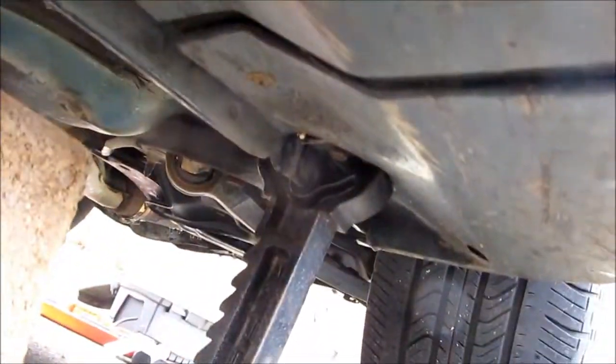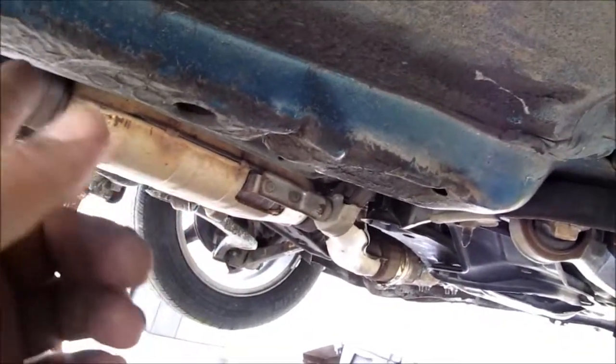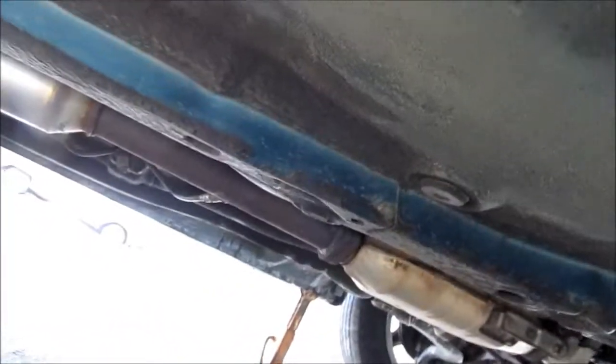Another kind of interesting thing about these Mitsubishis, well, I don't know if it's Mitsubishis in general, but this body style, which I did not realize, is that you have to lift them by this lift point along the edge. Now, it was my understanding that you only did that for doing tires until I realized that if you put a jack on the actual subframe, it doesn't end up pretty. There isn't much metal there. And I'm not the only person to have apparently made that mistake, because both sides are all boogered up all the way down. But I just thought that'd be an interesting, useful thing to you Mitsubishi owners. Or prospective owners, or rather DSM owners, because this isn't so much particularly Mitsubishi. Never mind.